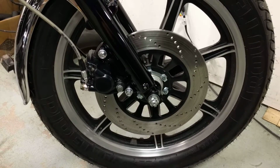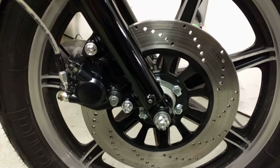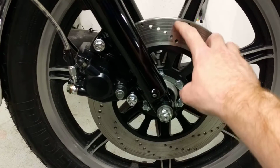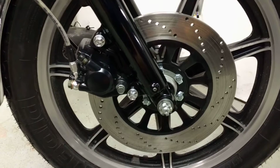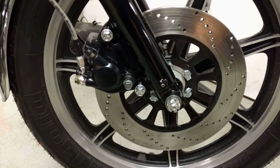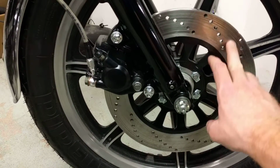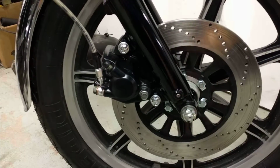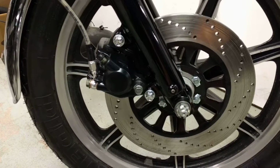Hopefully, from what I read online, with some time, these ridges are not that deep. You're talking maybe 5 to 10 thousandths of wear in here. The rear was worse because whoever owned this bike was a rear brake rider. But what I've read is that with this being done, all these ridges will actually clean up over time with the friction and the grinding of the pads against the rotor. So that's another thing that'll be yet to be proven.